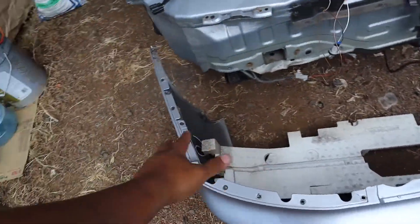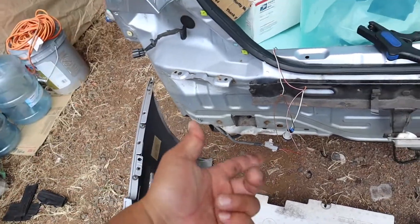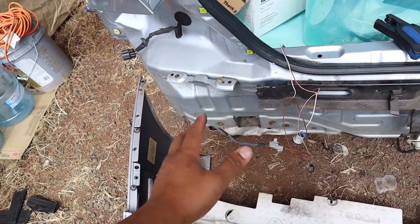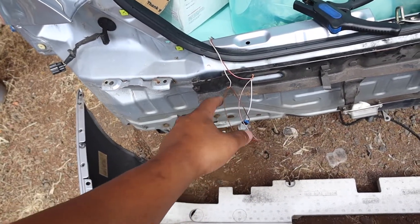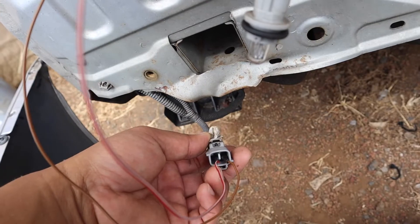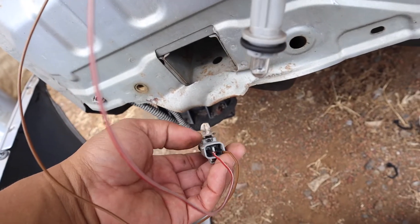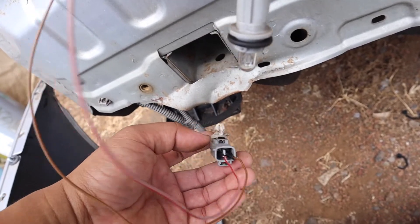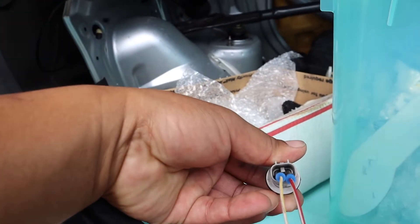As you can see, I did jump a little early on working on Jalen's Evo. I decided to remove the rear bumper because I noticed the license plate light wasn't working. When I took the rear bumper off, I noticed there wasn't any harness. So I drove down to the auto shop, grabbed some wires and some terminals. I couldn't find any aftermarket plug that would plug into the socket bulb or harness, so I decided to put some terminals on with heat shrink tubing so the terminals won't touch each other.